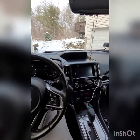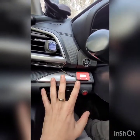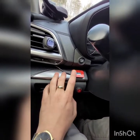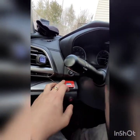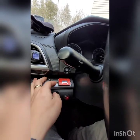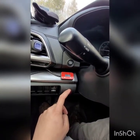Alrighty, so now we're inside Nova. We're gonna go from left to right in the front, and then we're gonna go to the back seat. Starting on the left at the top, we have my Ultimate 9 USA EVC Throttle Controller with the red faceplate. This has saved me a lot when it comes to merging in traffic, when I'm towing, and when I just want to have some fun or even save on gas. What this does — it plugs directly into the throttle ECU and basically remaps the throttle itself, getting rid of any throttle lag that the Subaru CVT does have. The switch here is for the light pods and the light bar, from Alpina Automotive.